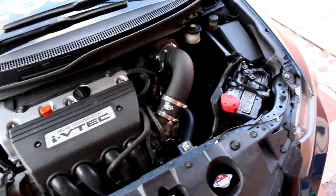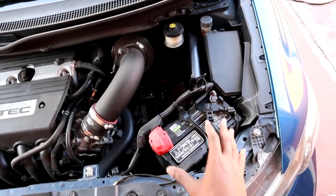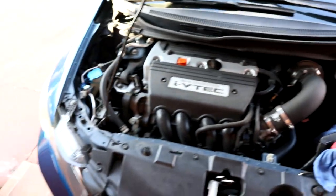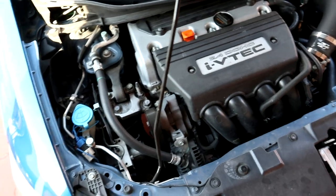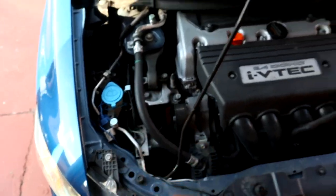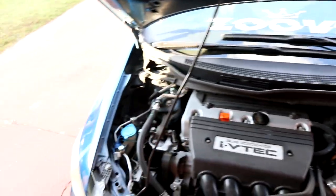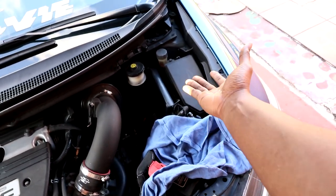What I'm gonna do is cover the battery — I have these rags so I'll just place one over the battery and fold it up nicely. Then for the alternator I'm gonna put a small rag over that one too. And obviously your ABS system and all that stuff — make sure water doesn't get on that, and your ECU as well.